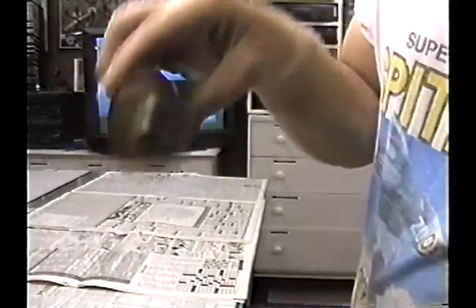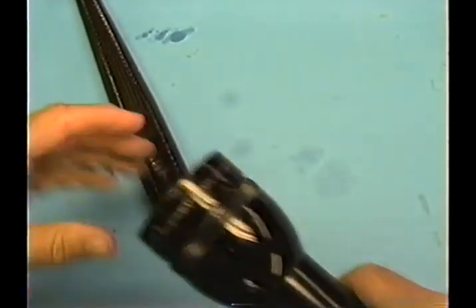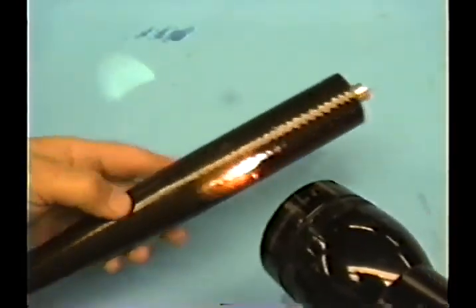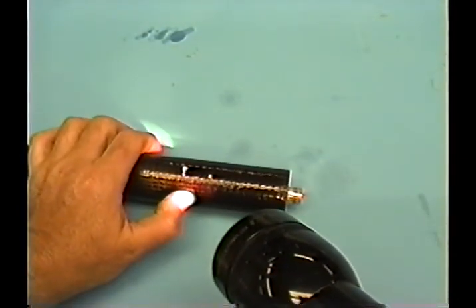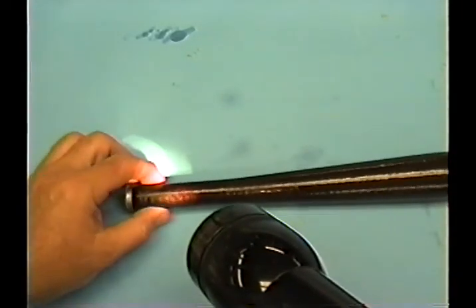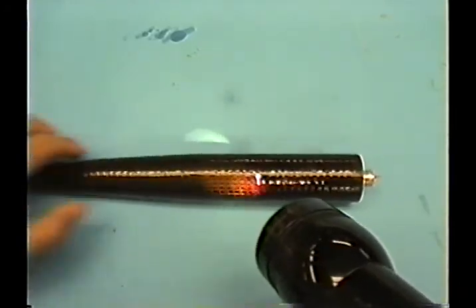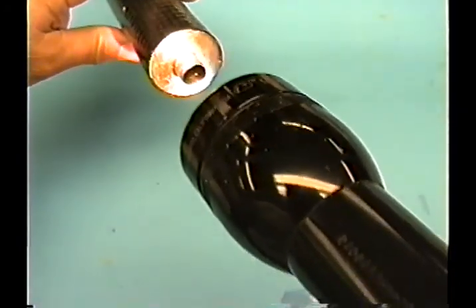Anyway, you can hear it. It doesn't matter what pipe you buy, pipes are always subject to this. Now you can see another thing, the way the resin is cured. Back here is where the baffle is, and this is where there's a hot spot. The resin has already changed color, same as it changes up here, because this is where they typically get hotter than normal. And back here where the baffle is, so it's probably telling you that the baffle is pretty restrictive.